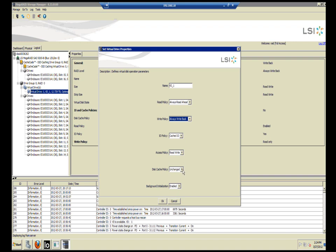I've got the access default read write, and of course the disk cache policy. Do we want to use that, or is that something that is going to be any improvement at all? I get some guys just say it doesn't matter. Well, typically the default there, meaning unchanged, is saying whatever the drives are already. So it's basically saying, do I also want to utilize the cache on the individual hard drive? Is that going to give me more performance? It typically does, and that's why I've not heard of a drive that has it and turns it off. So by unchanged, we're basically saying just go with whatever the disk is set to. Got it. So if for some reason the disk drive had it turned off, we would also say we want to not use it.